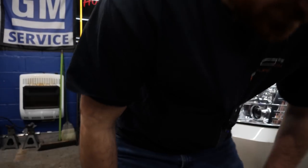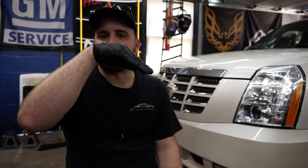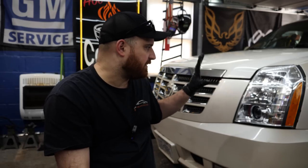So I know it may seem like I absolutely hate this Escalade — and I'm not going to lie, I kind of do. It annoys me more than anything because there are a lot of things on this that need to be fixed that I didn't have to worry about on the Tahoe. It's just because it's a newer vehicle — it has extra little bells and whistles. But also in my mind, I knew buying this — I knew the GMT900 is where it all starts going downhill for these. Not that they're still not reliable. It's just the stupid issues with the AFM, the stupid issues with the 6L80s and the torque converters, all these little things like with the daytime lights not working. These are all common issues with these trucks.